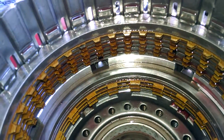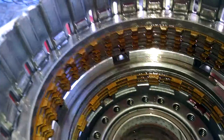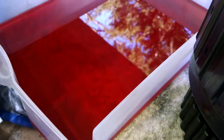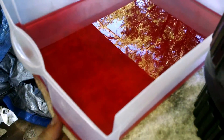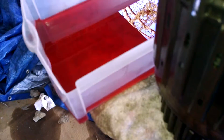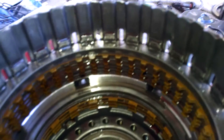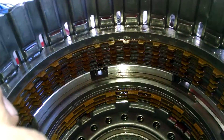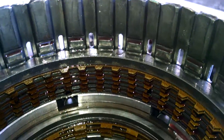Friction, steel, friction, steel, friction, steel — once you get the top locator ring in there, make sure they're all seated. Before you put the frictions in, soak them in clean, brand new transmission fluid for 10 to 20 minutes. I just throw them in before I get to that set, and by the time I get to them it's been 20 to 30 minutes.